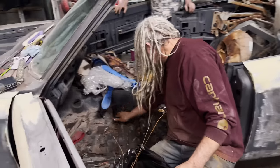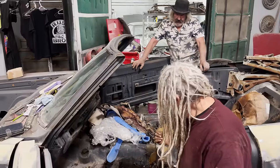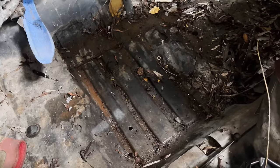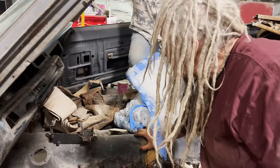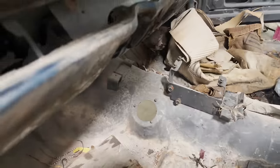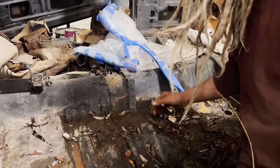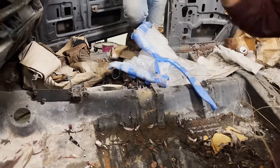Okay, the next thing. Yes, Blair. Okay, that cannot be. Either that is the wrong column, because this is an original floor. This is a bucket seat floor because it has these. So it could have been bucket seats, column shift, and then these guys were going to mount a console in it. But that looks like all factory stuff for the shifter. So I think the original column's gone, because it should have been bucket seats. If that's all factory here, it looks like original stuff, right? That's to mount the console. So it should have been console shift. It should not have had a lever.